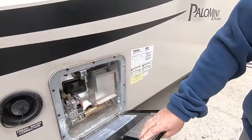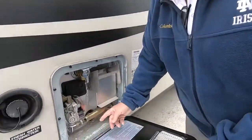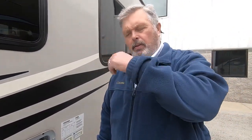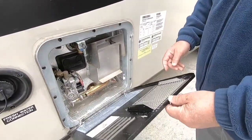This is the back of your hot water tank. There's really no maintenance in here. This is your plug — if you're done camping for maybe 2-3 weeks, I would drain the water out of there, only because stagnant water inside will start to smell after a while. It's just a simple screw it in, screw it out. This is a propane-only hot water tank, so you have to light it on the inside with a button and it runs off of propane. Keep it clean in here and make sure there's nothing nesting in here also.